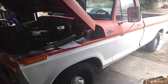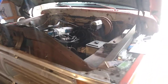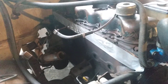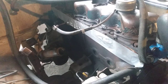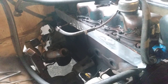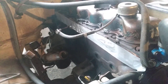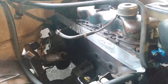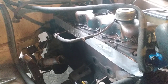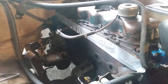The tags are up on this truck in March and I've got to get it through inspection, because it's not tagged antique. One of the failure points would be the exhaust manifold — it had a bad leak, namely the donut gasket. But it's not simply a matter of replacing the donut gasket, because the studs coming out of there are rusted out and stripped. There's no way to repair or remove them — they're frozen dead into the exhaust manifold. To try to repair it while attached to the engine is nearly impossible; once it's heated and cooled over 40 years or so, it's a nightmare to work on inside the vehicle.